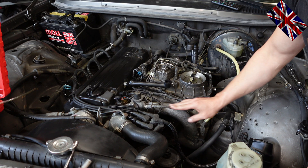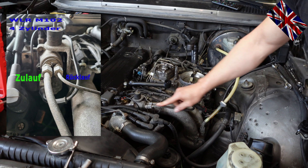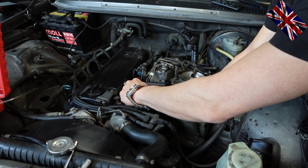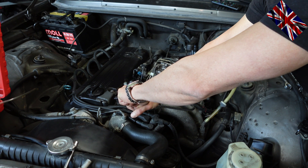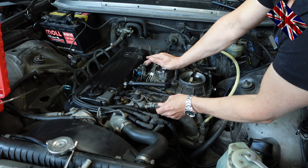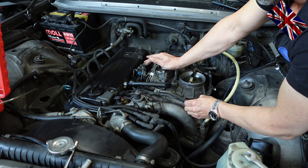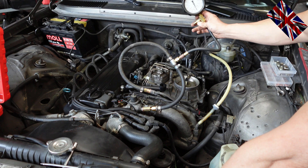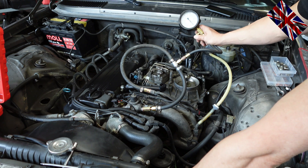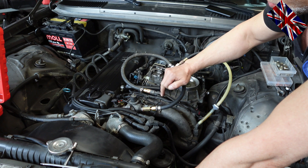We need to disconnect this fuel line to bridge it with our pressure gauge — it is the influx port from the flow divider. The recommended tool is an open ring spanner; using that one here because the distributor cables leading to the spark plugs are in the way. Beware of spillage — goggles and cloth are advisable. Lucky me, this car has not been running for some time, therefore no pressure. Right here in between we install our pressure gauge. Just installed and fully connected. The hoses are long in this case because I used this tool for measuring other components as well; a short T-connector would have done the job. Nota bene: we have bridged the fuel line from the flow divider to the WUR to check pressure.